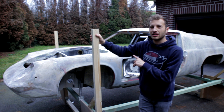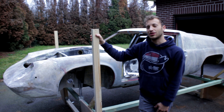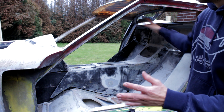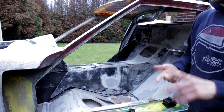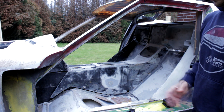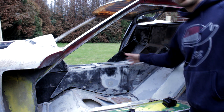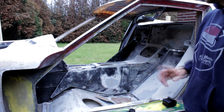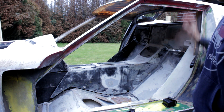We'll take a look at the cabin and how I'm planning to make the roll cage, then go on to the installation. I've put in the seat backs so we have an entire view of the interior. I want to install a roll cage but also have it removable, so I can unbolt it for a normal interior and bolt it in whenever I need to. The hardest thing is we have only fiberglass to bolt it to and our backbone chassis, so we have to pick up our mounting points from the backbone and build up the cage from that.